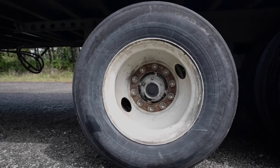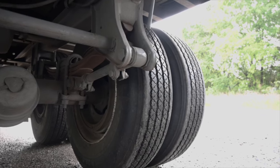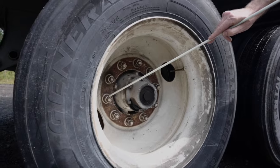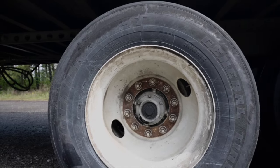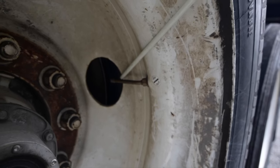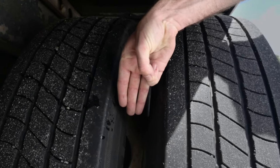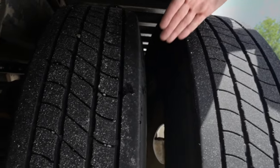Trailer wheel group. The tyre tread must be 2/32nds or more of tread depth in all grooves. The tread is evenly worn with no abrasions, bulges, cuts or other damage to the tread or sidewalls. The tyre must be beaded properly to the rim with no leaks around the rim. I would check the tyre pressure with a tyre pressure gauge at the valve stem. The valve stem and valve cap are not missing, broken or damaged and are not leaking. Tire space — there must be at least three fingers of space between my tyres. Tyres are not touching and there are no foreign objects lodged between them.